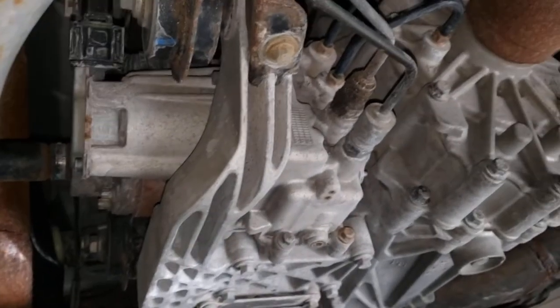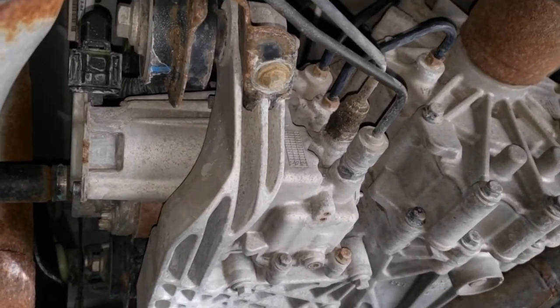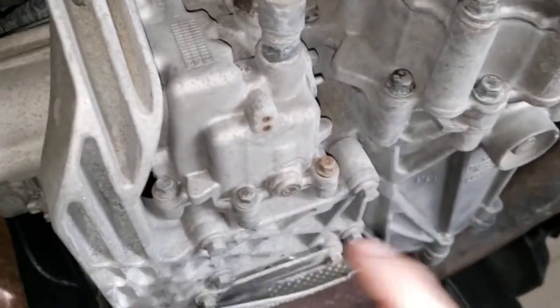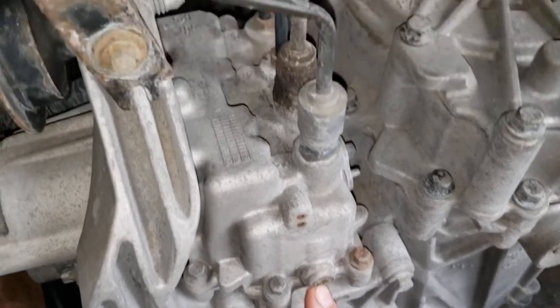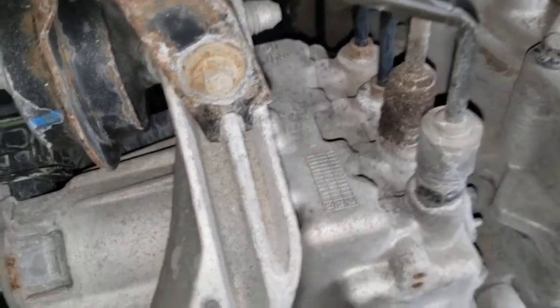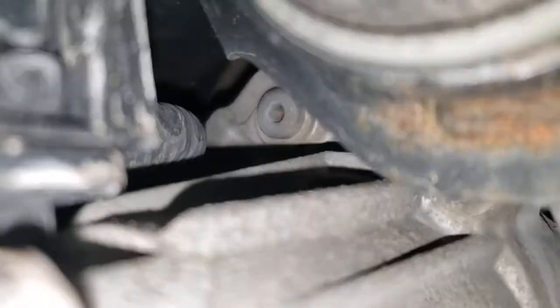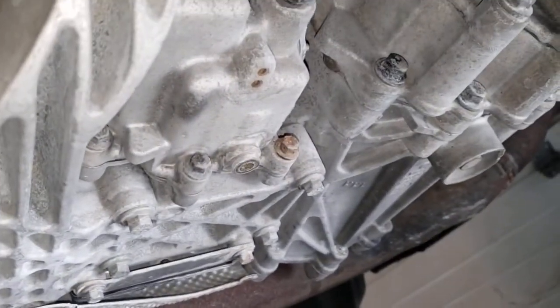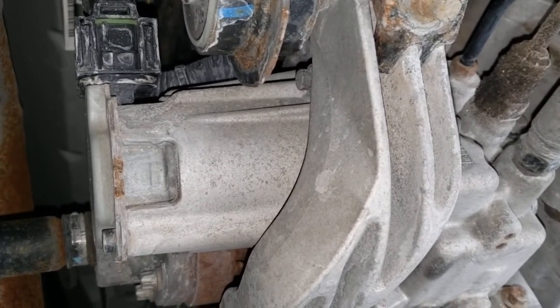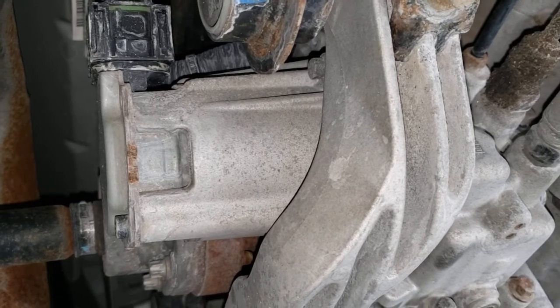This is the coupling - the GKN Gen 5. From what you can see here, there's a very small plug right here that's the drain. If you read the side of the housing, it says 'oil in.' On the back side there's another little plug you pull and pump fluid in. In order to get most of the fluid out you hit that little drain plug. I'm also going to pull the pump because there is no filter on this unit - just a little screen filter on the end of the pump - so we'll take that apart and see what it looks like.